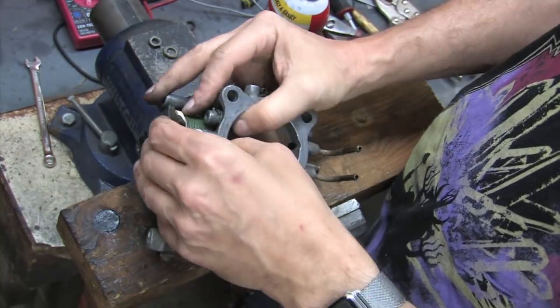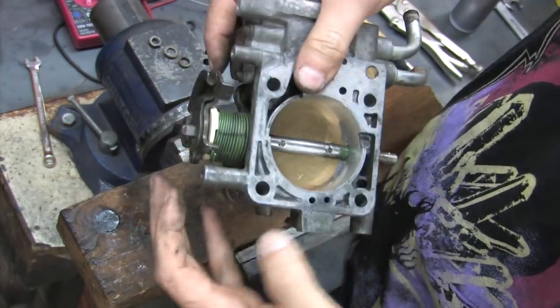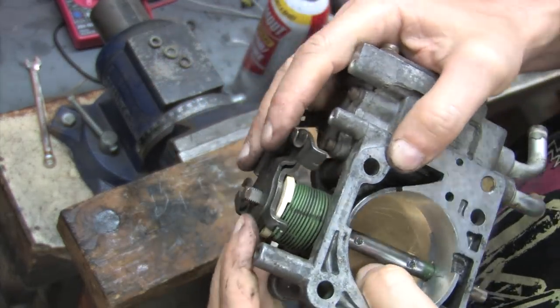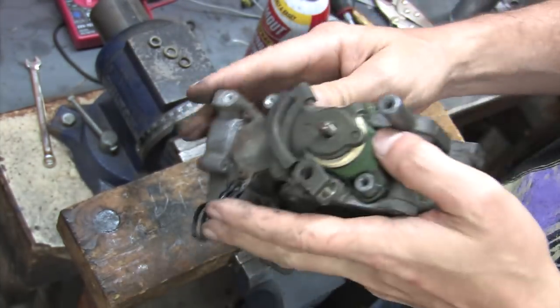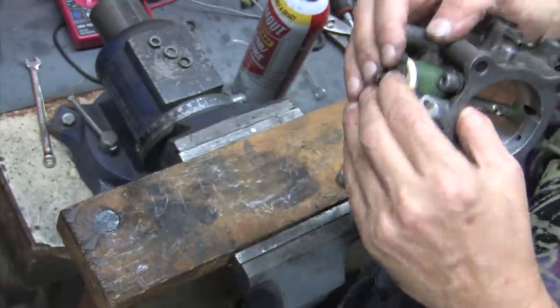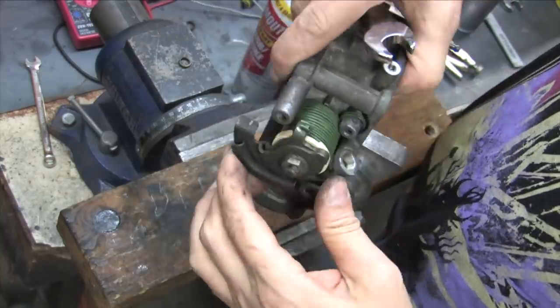Clearly I'm not. When the throttle stoppers line up on the linkage and the throttle body, push the linkage assembly all the way down onto the throttle shaft. If you marked it, your springs will line back up again, telling you that you got it right. It tells you that the springs will have adequate pressure to close the throttle plate on a running engine. You're not done yet, though. Attach the lock washer and the nut.